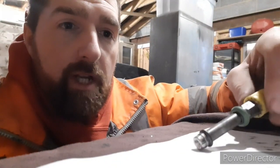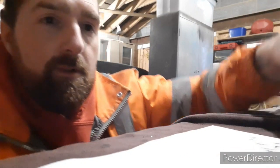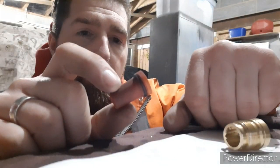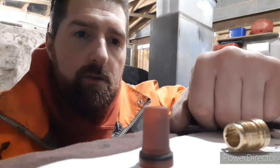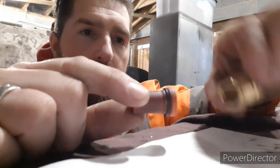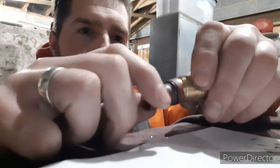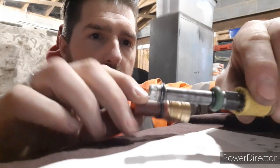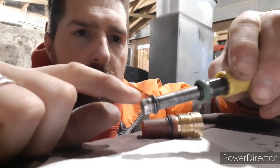I'm just getting ready to put the injectors in and I've got one in and all the new top hats. This is a K-Jet air shrouded injector. The air shrouding is made up of these parts: you've got this bottom bit — these always fall apart, you'll struggle to get them out unless you remove the lower part of the manifold. You have this part and the rubber seal, which is a square-sided seal, and this is a brass that clips into that bit there. Then you've got the injector with its top seal and the bottom seal.